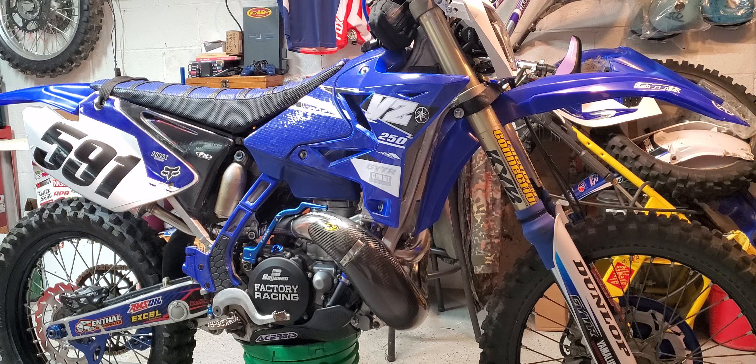When you're putting through the woods, going over trees, logs, or rocks, you can stall at any moment. The flywheel weight is definitely a must-have for off-road and woods riding. It gives a little extra low-end grunt and less wheel spin, which helps a lot especially in muddy conditions with leaves on the ground.